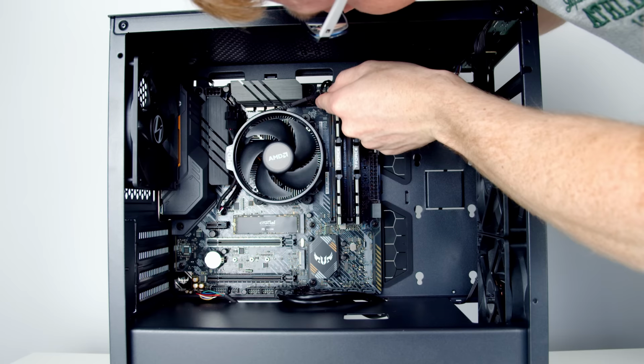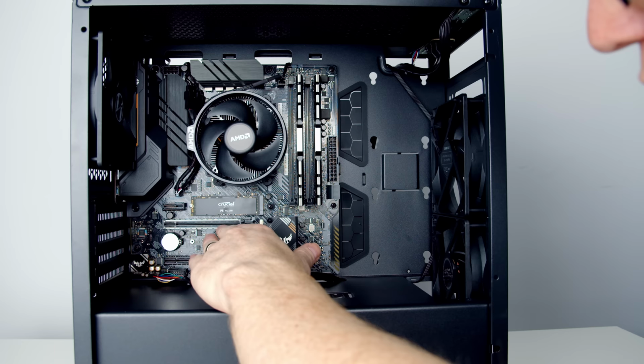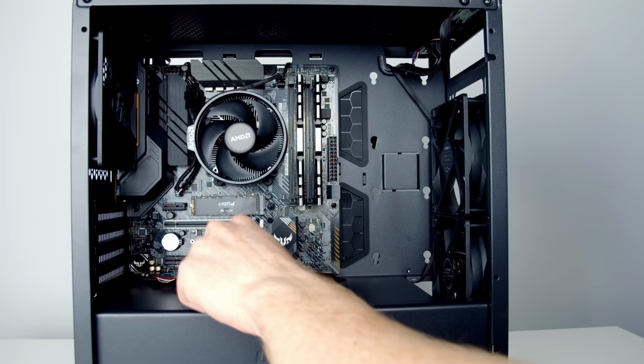Okay, and then we'll just pull the excess cable out the back. So hopefully you can see the reason why I've added this fan in. If we had just run with this fan, our graphics card, which is going to be sitting here with intake fans down the bottom, most of the air coming through here is going to be above the graphics card. So I think this additional fan down the bottom is going to be blowing some air along and help the graphics card get air, particularly when all this panel at the bottom is solid.